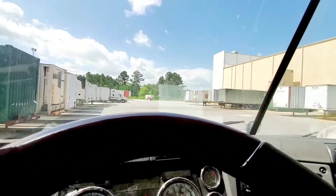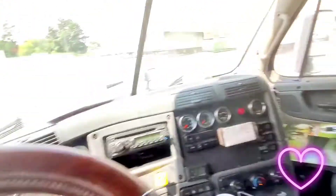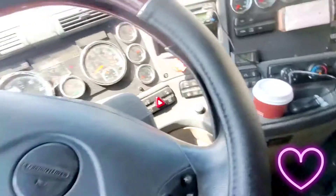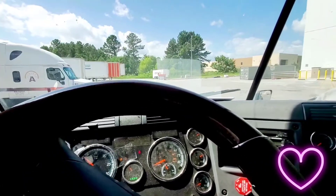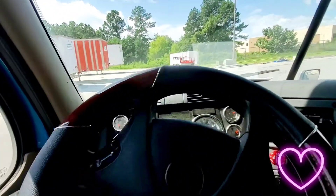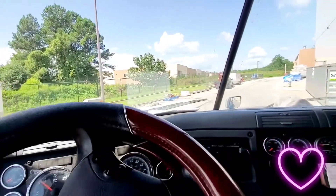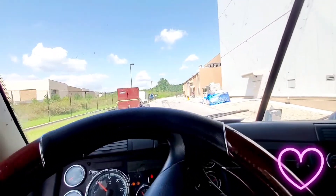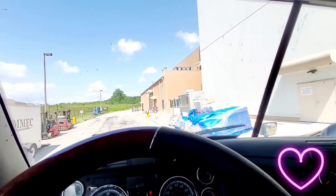In that case you can move the truck, and after that you don't use any clutch anymore - just put the truck in gear straight and you'll have no problem driving as long as you stay in gear. Before you stop, let it roll down a little bit but don't completely stop. If you have to make a complete stop you have to turn off the truck, put it in gear, and start again.